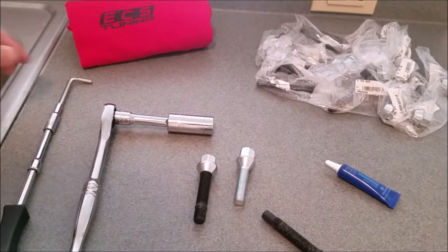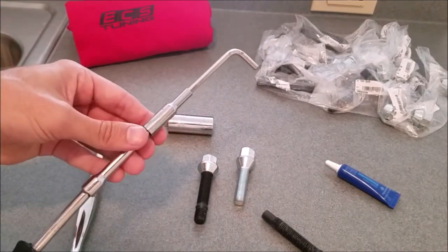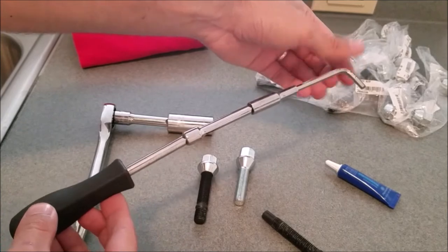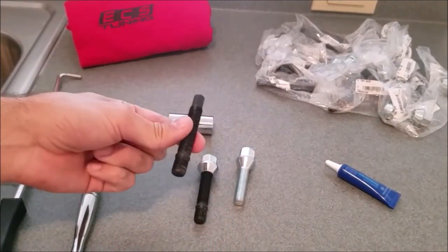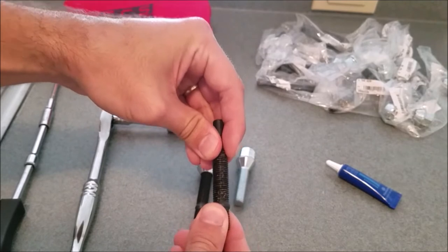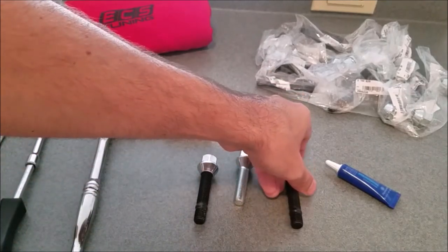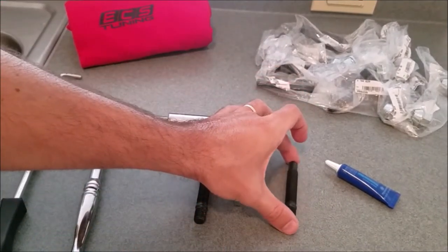ECS Tuning's website has instructions on how they want these tightened down. They want them tightened to 7 foot-pounds, and while I don't have my inch-pound torque wrench here, conveniently from this axis point to the end of this handle is 12 inches — so this is one foot. If I apply 7 pounds of force at this handle, it's going to apply 7 foot-pounds to the stud. These do not need to be tightened down very tight; the only reason you're tightening them at all is just to keep them in place. The stretch of the stud as it gets pulled by the nuts to clamp down the wheel and hub is what's going to hold your wheel on. If you tighten them too much, as you apply load it's going to lean the stud off-axis — so you want these just tight enough to stay but not too tight.